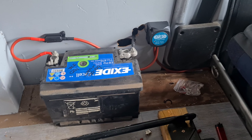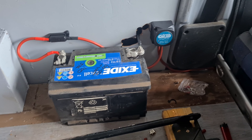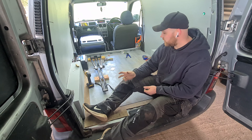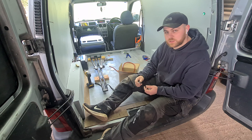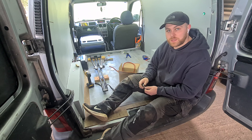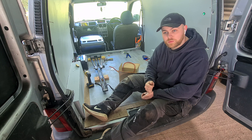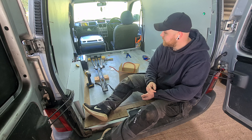All I need to do now is put a bit of batten in around here so the battery doesn't wiggle around, but that's for another day — I'm done. That is episode 3 done — split charge relay, tick! Recap: we've installed our second battery into the back of the van along with our split charge relay kit. I'll leave a link in the description so you can pick up exactly the same kit — super easy. The hardest part is probably running the cable into the back depending on your van; the rest is a piece of cake. Give this video a like, hit that subscribe button — I want to hit 1,000 subscribers this year!